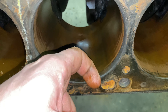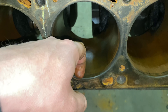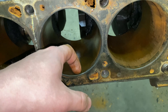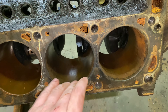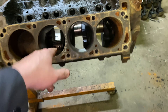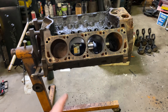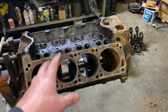Your wear is always more pronounced on the bottom because it's laying down with gravity, going up and down. But it's just ever so slightly — I can feel just the slightest little bit of a ridge, and I think it's mainly carbon. I could probably take some sandpaper and knock it right down. That's a good sign. That tells me this motor is very low mileage. It's all original and never been built. I have a 70 model Cleveland that is all original and never been built, and it has a ridge in the cylinder walls. So this is really good news for my application and what I'm wanting to do with this motor.